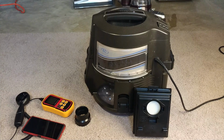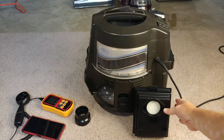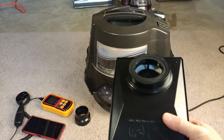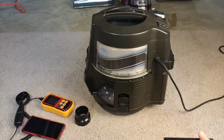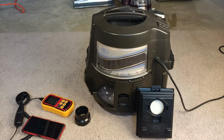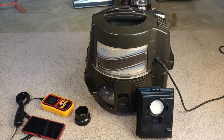It's been a little over 24 hours that I've made an attempt to do the best job possible to fully dry the previously icky, smelly rainbow exhaust filter. Now what you see right down here is a brand new one. So see how nice that is? And also same thing up here, nice and white. So I know with this filter installed on this machine, we got about 97 CFM from the intake right there, and the particle count from the exhaust was 6 0.3 micron particles, and the other two sizes, the 2.5 and the 10 micron, were both zeros.